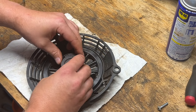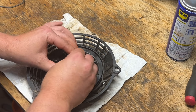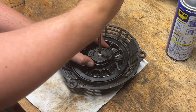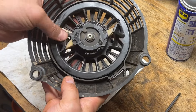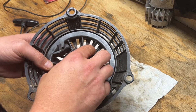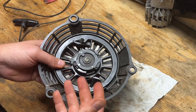This piece goes back on, and then the screw — remember reverse threads, so this is actually left to tighten. The pawls are shooting out, so we're all good. One thing to note before we wind this back up and put the starter rope back in: there is such a thing as too much lubrication. You do want some in there between these parts so they move freely, but too much will start attracting dirt and act like sandpaper, wearing these parts out. So don't gob it on there, but do put some in.